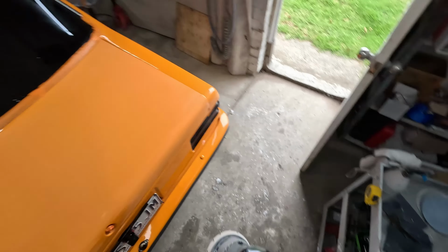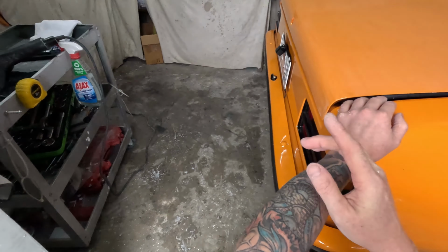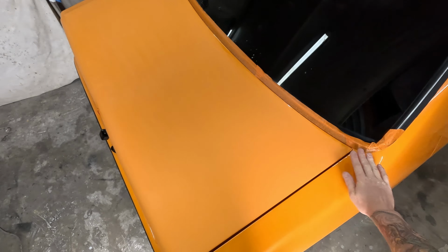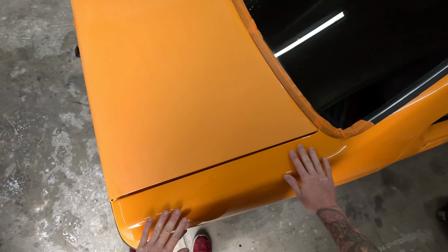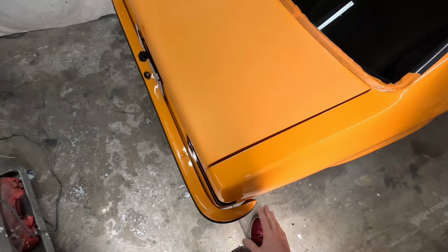Now what I've decided to do is down the sides, when I painted this, I only put 3 coats of clear coat, right? I did that because I was always planning on just hitting it straight with, say, 1500 or 2000. I might just go straight 2000. So when I'm 2000ing this, I'm going to do the top of that quarter panel as a bit of a test panel, just to show me what I can expect from down the sides.